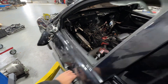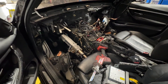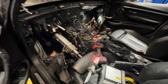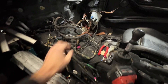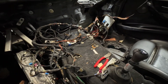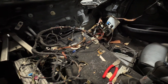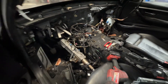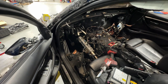Door still opens pretty good for a rollover. All the major structures have been removed inside and we're just left with the harness. Here's the harness that goes behind the dash — a lot of it's connected to the body control module there in white. We're going to keep all of that intact, remove it entirely from the car, and thin it once it's out. We've kept all the plugs and connectors intact so we can identify what goes where.